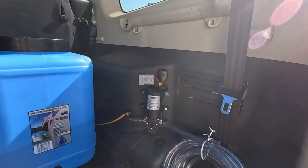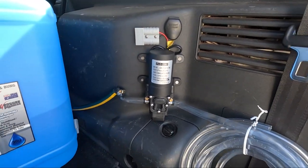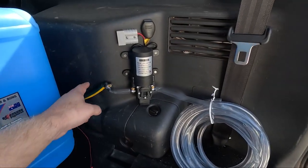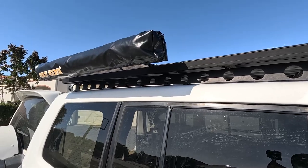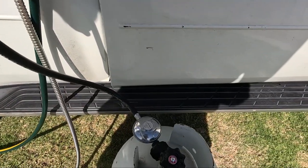Apologies I didn't record a lot of this stuff — it was just too hard — but I'll show you what I've done and then I'll show you the gear. So this is where I've fitted the water pump, just with these four screws here. That was the Anderson plug I've fitted there, so I'll connect that one up in a sec. There's a water container here for the water. I'll run this into this drum here, and this is the hose that runs all the way around to the hot water system. The one on the left there connects up to the shower head, which obviously goes up onto the shower curtain there. And this one here runs down into the gas bottle.